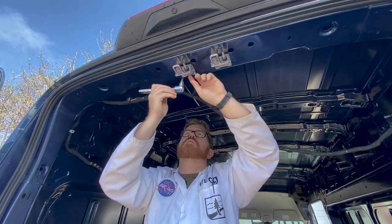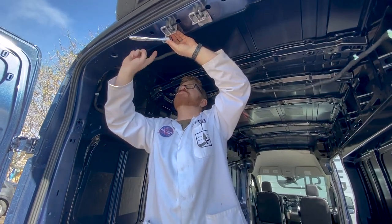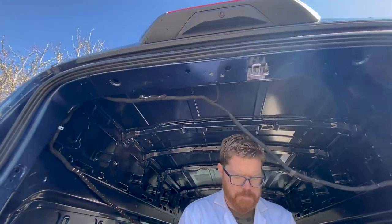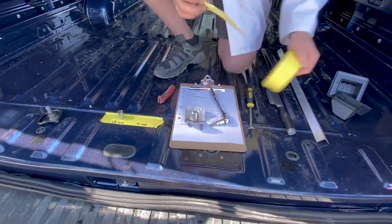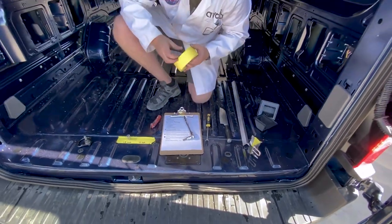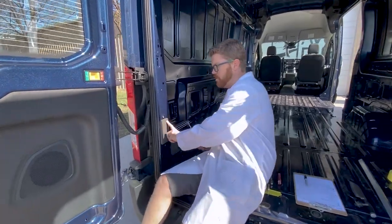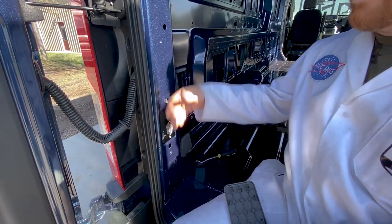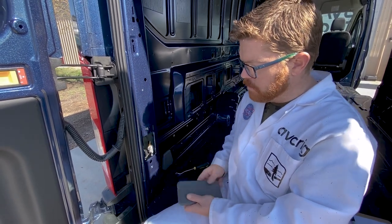We're going to grab our T40 and pull these rear brackets off so that we can upholster this rear column. A lot of people don't upholster these columns and it just makes the van look unfinished — we have another video coming up that will show you how to do these in-house. Once the hardware is out, I put it back in that cleat and tape over those bolts to make sure they stay with the bracket, because it might be a couple weeks until you get those put back in. These door catch brackets are interchangeable — it doesn't matter which one's right and which one's left. We're also going to take these plastic covers off; they just pop out and pop off.